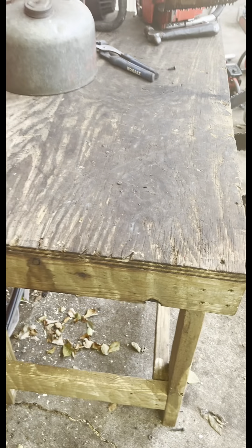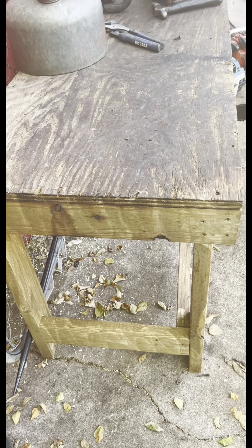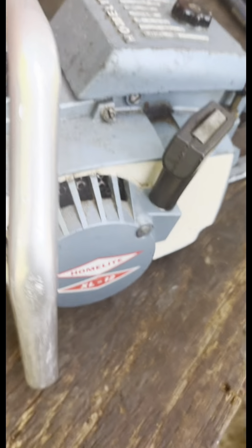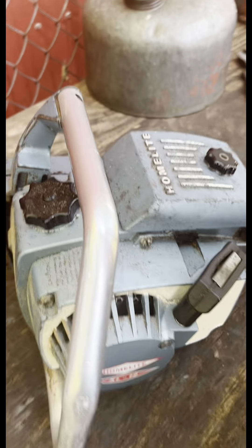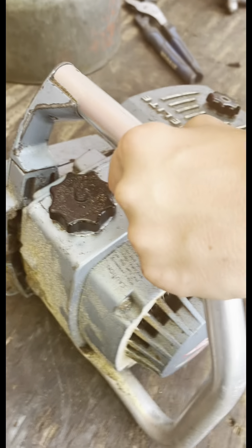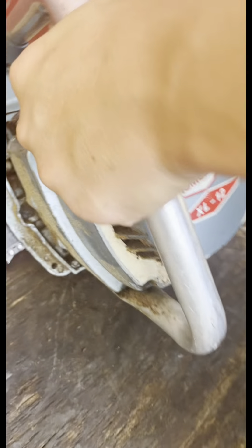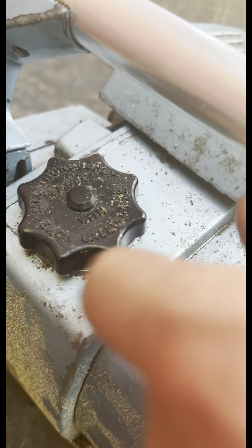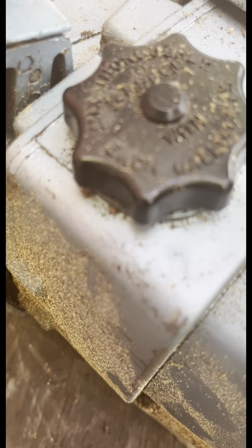Probably the 1965 XL12, also in very clean condition. On this one they moved away from the shorty spark plug — just a regular spark plug. This one no longer has the wicks fuel system in it. Yeah, '65, '66, something like that. Another way you can tell if it's an early one is the gas cap style and the air filter knob style.